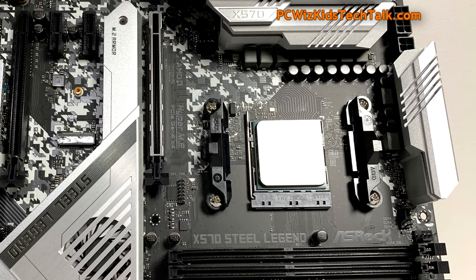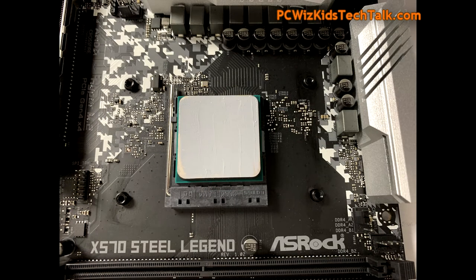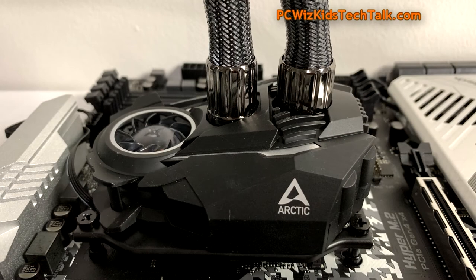There is the board with the two brackets. I go ahead and unscrew those — basically they're gone. Now it exposes the four screw holes. I put some thermal grease — just a very thin coating on the top of the CPU. Not too much, just a nice thin layer. Some people like to just drop a pea-sized amount in the center, but I prefer to actually cover the whole surface area with a very thin coating. Then I orient the pump, put in one screw at a time, alternating diagonally in a circular motion to tighten it nicely — not over-tightening, just snug so it doesn't move.